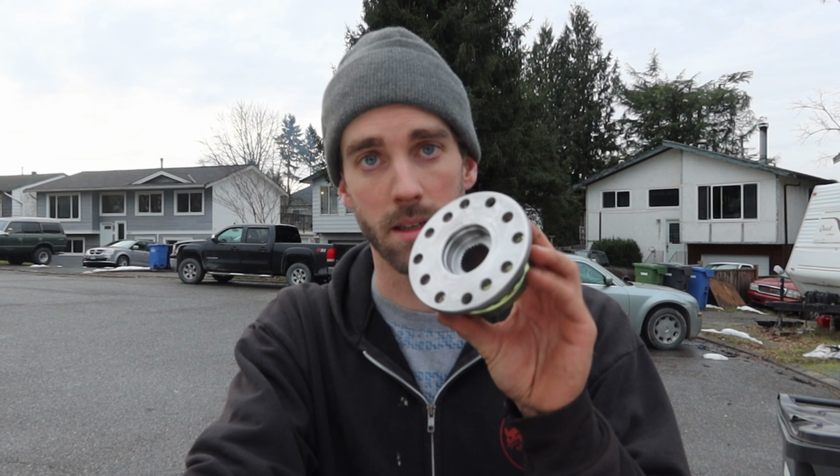Okay, so this truck is just kicking my ass right now. I have been dealing with driveline issues time and time again. I can't seem to get it right. So what I did is I bought 4-cylinder diffs that have 410 gears in them, and then I bought these triple drilled flanges, 27 spline. They're supposed to bolt up to a V6 drive shaft, which my truck has, but they don't. I'm a little bit frustrated right now. It just seems like every single time I take apart the driveline on this truck, I have nothing but issues. I'm really looking forward to it being over and done with, when I don't have to swap gears or drivelines or anything.